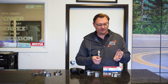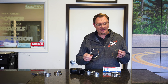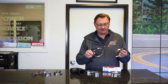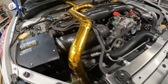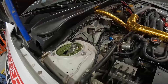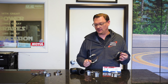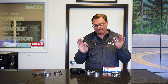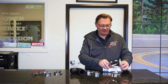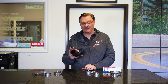Because it's a worm drive clamp, you have a lot more range of adjustment — more range, better seal, harder to over-torque, and it's not going to wear your hoses. Ever since we found these and started using them, anything to do with the cooling system or anything under pressure on the boost system — like intercooler hoses, turbo hoses, all that sort of thing — we've been replacing them with these clamps and we've not had any issues since. If you're chasing a boost leak, having issues with T-bar clamps, or you find that your worm drive clamps have been eating your hoses for breakfast, maybe take a look at these constant tension clamps. They are definitely the best solution we have found for holding pressure on hose and keeping them sealed tight, keeping the coolant where it needs to be, and not having any vacuum leaks.